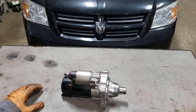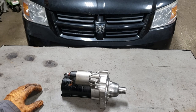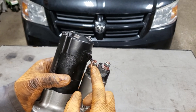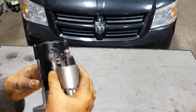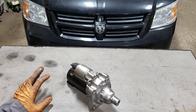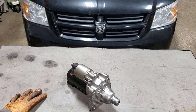Sometimes it may look like it's attached but they corrode internally, which makes your life quite a challenge because you may have a ground if you test the ground at the engine. The only way to really test that is to take a jumper cable, run it from your battery to your engine and make sure that you don't have a ground issue. For this particular starter motor, what's happened is that wire has completely severed because of the amount of electricity going through it. As the wires corrode you have a lot of amperage coming through just a few strands and then it essentially melts. It is important to check the ground and the connections to the starter because we have had cars come in diagnosed as a starter by another shop and sometimes it isn't the starter. Most times it is though.